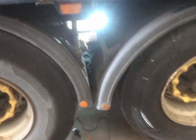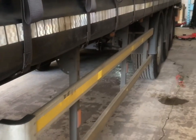Grey one. Yeah. Right, so the first test came back inconclusive. What we're going to do now is, this is the Susie. It comes from there. I've got it to here. I've got it in pin 4. I'm going to check where that wire goes into there. We're getting there. I'm going to check that pin 4, that wire in that plug, to see if there's any resistance in it. And we're going to check it on the others as well to see if it's tracking.